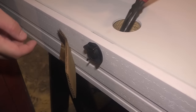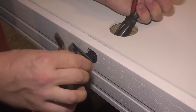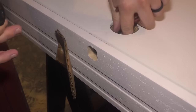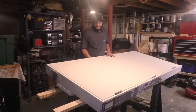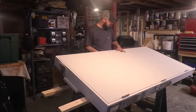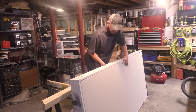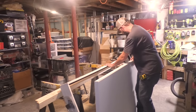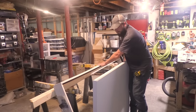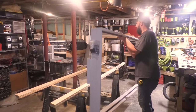Sometimes you need to hold the plastic piece on the inside from turning. You just twist it, pop it off like that. Now to make this easier, I'm going to tip this up and drop it so that I can get that door out. Now I can put the door aside.